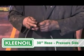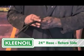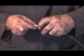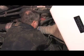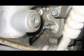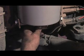Prepare two hoses with wire loom. Put a 90 degree fitting on the end of one hose. Connect the 90 degree side to the fitting on the pressure side of the engine, and connect the other end to the inlet side on the bottom of the clean oil bowl.